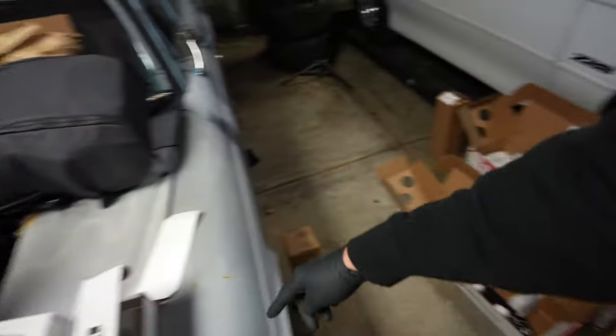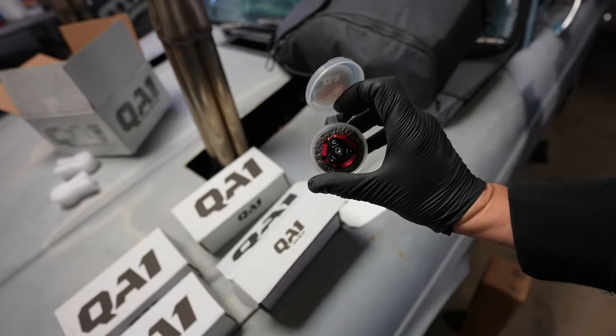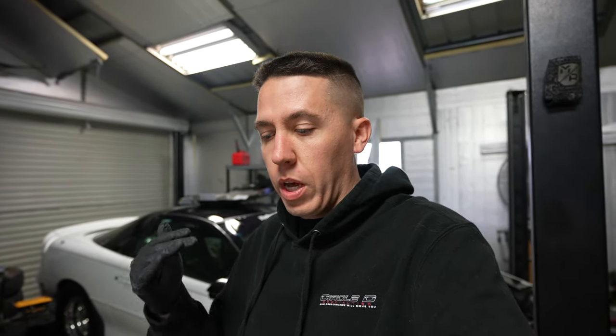As you guys saw in the last video where I was weighing the car to possibly do no prep and put weight in the back - we put weight in the back, we'd swap to the no prep valve setup packs. The coolest part is you can just unbolt these five little bolts right here, pop that pack out, come over here - these will be already preset from the last outing. Once we get them tuned in, grab the no prep packs, insert them, install them, and then we're done. We can already have a really good base depending on the pack we have in the shock going from radials to no prep really, really easily. That was one of the biggest, coolest things about why I really wanted to use these QA1s - to make ease of changing the car around for drag and drive, radial prep, whatever we're doing. It'll take a long time to get the tuning set up, but I'm planning to use QA1's information to give me a good base setup. They think we'll get a long ways with just one pack.